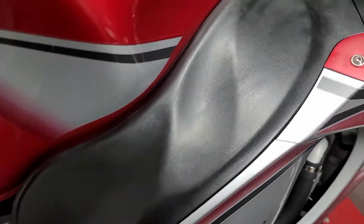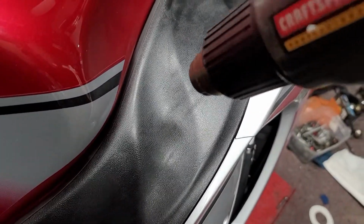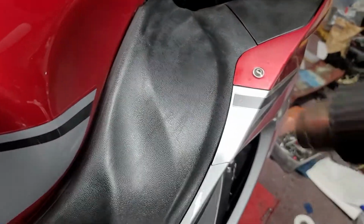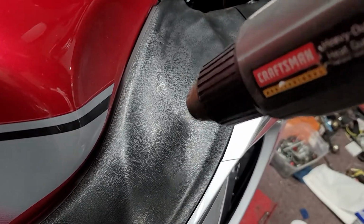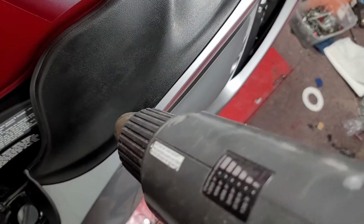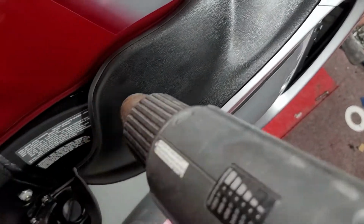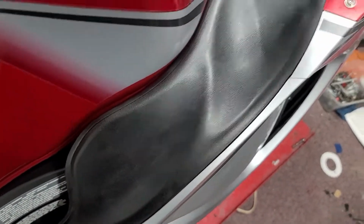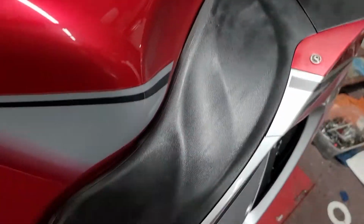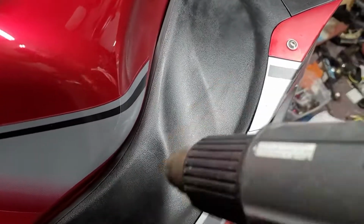You can still see some of the little layers here where I went across it. So you could try to be more thorough and make sure that you get it exactly right. I think so. I'm seeing that when you go this way and you stop to come back, you've actually gone over this spot and sat there for a second. So it might be better if you just go across the entire thing all the way up and then come off and then come back and start another line. Or maybe a circle pattern or something, so that you're getting the same time over everything, and try not to overlap. It's kind of similar to spray painting.